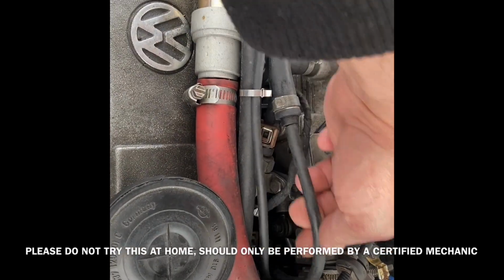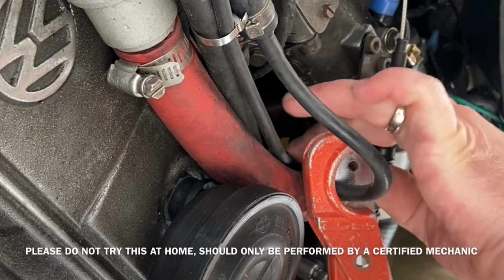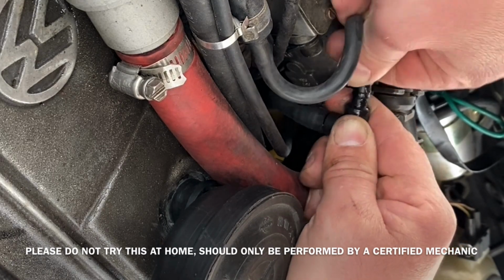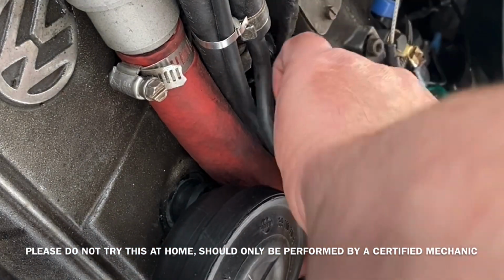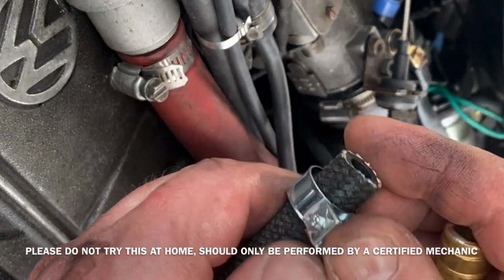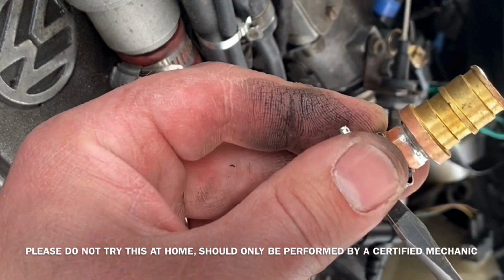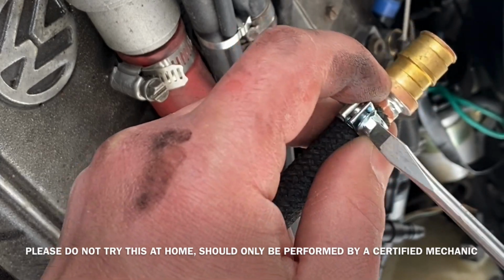After I was completed connecting all the lines to the master cylinder and bleeding all 4 brakes all around the car, thanks to my beautiful wife, the last thing I need to do is install the check valve for the booster vacuum system. So I connected the T off of the main vacuum line off the intake. It's the port that connects above the ISV valve, idle stabilization valve. I used my own brass fitting that I'm going to plug into the booster. They do sell a 90-degree fitting for this, but for me it was just easier to go straight, so I soldered my own together.